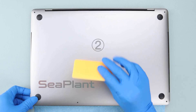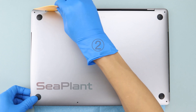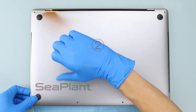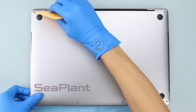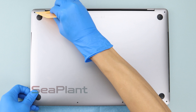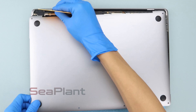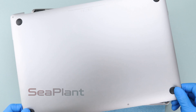If you can't pull it out with your hands, place a plastic card at the position of the display hinge. Hold the middle of the plastic card and fold it back with proper force. In the meantime, use your other hand to pull and remove the lower case.